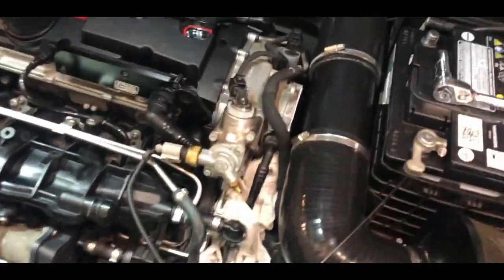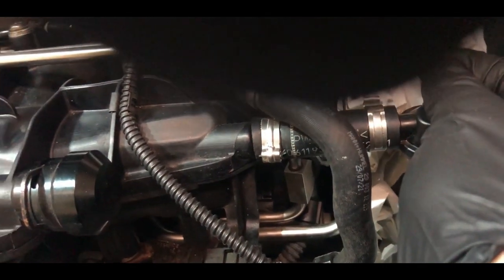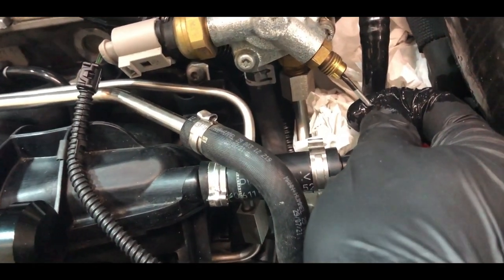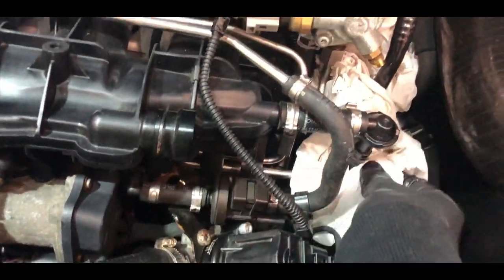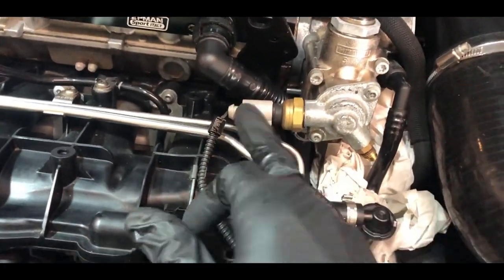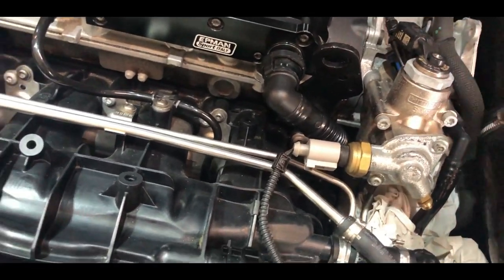Battery's disconnected. Get your little screwdriver down here, you'll feel it when you get there - just push it and there you go, that releases all the pressure and fuel. Now that's drained out, just want to wipe it all down. Next we're going to disconnect these plugs - same tool, just pull that off. There you go, one-handed, pretty easy.